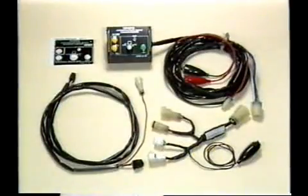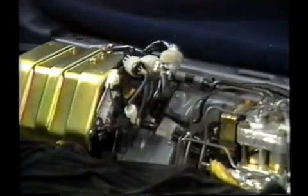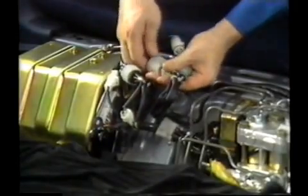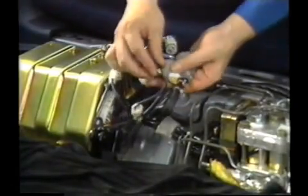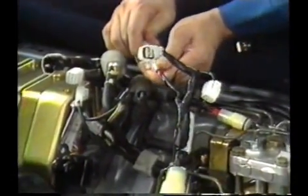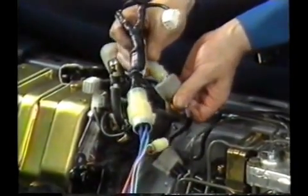In the case of a four-wheel drive vehicle, the long sub-wire harness is not used. 1. All 3 connectors connected to the actuator situated under the back of the rear seat are disconnected. 2. The connectors of the actuator checker are now connected to the actuator. After this, it is the same as for a front-wheel drive vehicle.